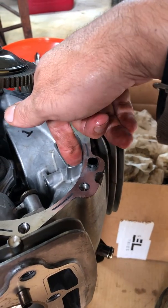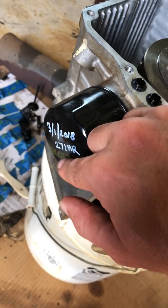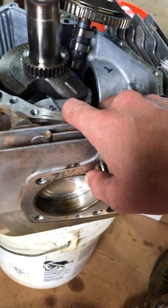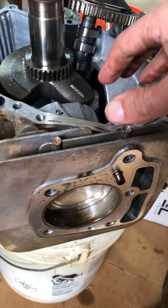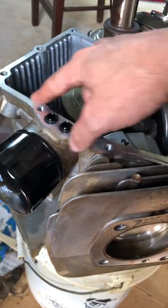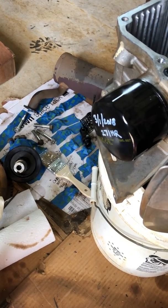The engine had been running reliably for about 271 hours — that's when I lost the push rods. I'm right on here with the hour and date for when I did the oil change. I changed the oil when I lost my push rods. Then at about 310 hours, the whole engine just — I could hear it when I was driving and the engine just shut down. I heard oil spraying everywhere and it was just bad noise from there on. So I'm hoping I can put a new piston in here, get all the gaskets set, use gasket sealer between the crank cases, and put everything back in. I have it all labeled for which parts and bolts and screws go where.